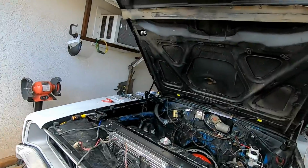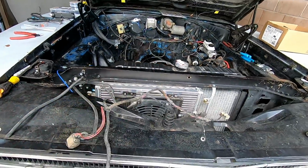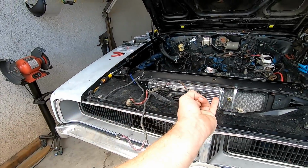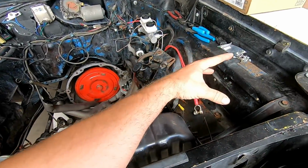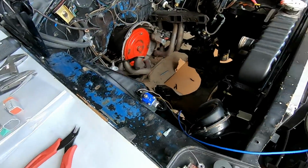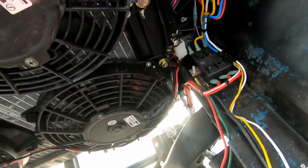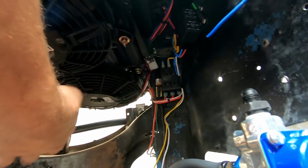We got the fans all wired up, that's all done. If you notice, there's dangling wires here. Well, what I've done is I took the headlight harness and flipped it. So I've gotten rid of all the wiring and all the vacuum lines that run on the inner fender there, because I'm converting the car over to relays. So the headlights will be operated by relays. I got all my fuse panel there, which also sends the power to the fan. So all the wiring will all be prettied up once it's all done.